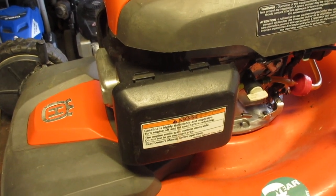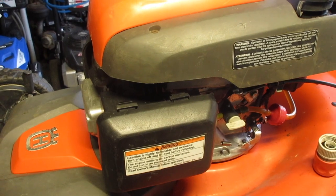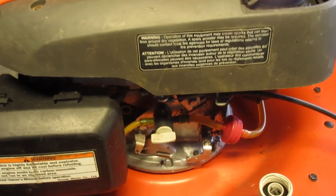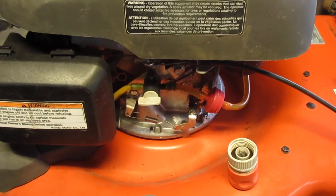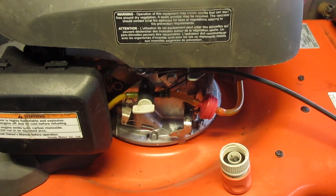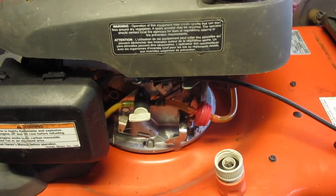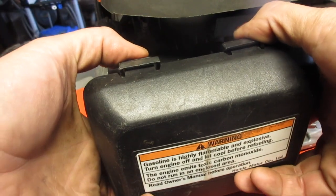We're going to clean the carb. This has, I believe, one of those wax pins. It's supposed to be an auto choke system. We're going to replace the wax pin, replace this funkery of the fuel line, put a new cable on it, sharpen the blade. I probably won't show that one. And we will just, like I said, generally defunkify it. So let's get started.